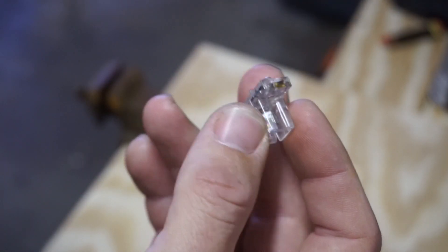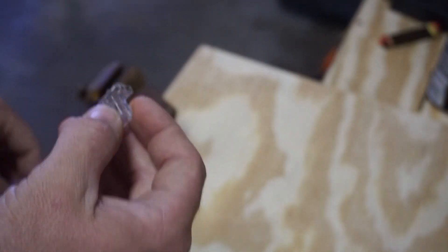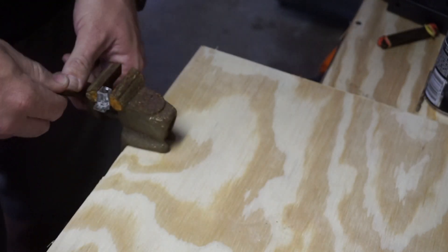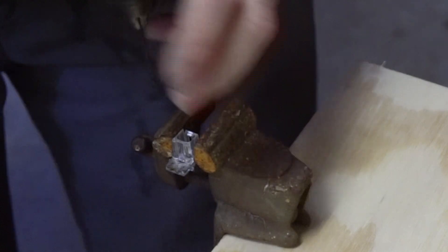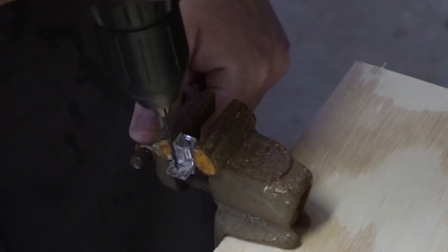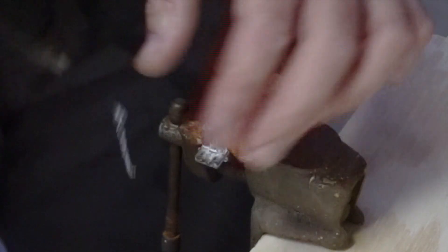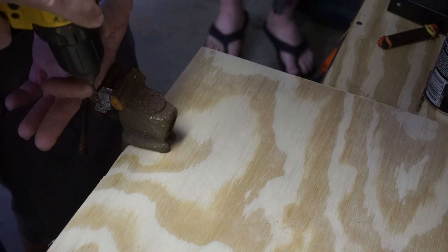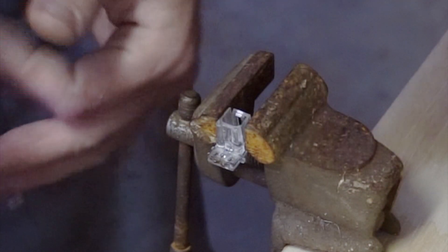So now we've got our factory LED lamp and our LED replacement bulb. You can kind of see that bulb's gonna fit in there pretty decent. We're gonna throw this in the vise so you can see what's going on. The reason why I'm doing it this way is so you can clip this back into the factory position and it holds that LED steady - it doesn't fall out. The next task is to look at the lens on the bottom and try to center your drill bit to the center of that lens. I'm starting with an eighth inch drill bit as a pilot bit so it doesn't walk on me too much. I can get a good idea of where I'm at before I drill my final hole. You want to keep checking on the bottom side - you'll be able to see on that lens once you're finally through. Good thing is, if you mess this up you can go to the dealership and get another one of these halogen-looking LEDs and start all over again for pretty cheap. I can tell I'm getting to the middle there because everything just changed color.